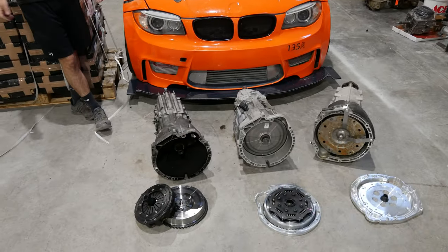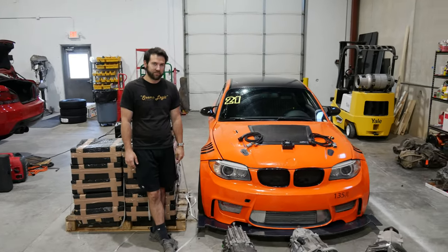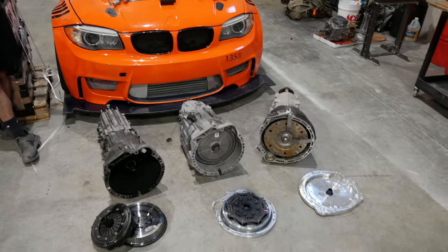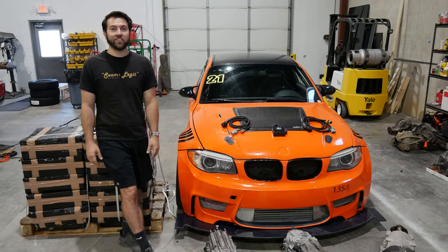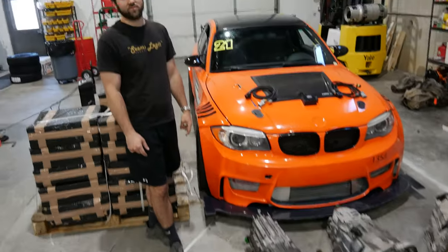With the 8HP I don't have to change my rear diff at all. It has the 3.27 in there now — we're going to leave it in there. You can make adjustments later if you want, but it's definitely not necessary. I could go back down to a 3.08, but the 3.27 was a little sportier. If you do half-mile highway stuff then sure, keep the 3.08, but this thing doesn't need to do 200 miles an hour.